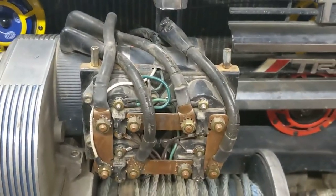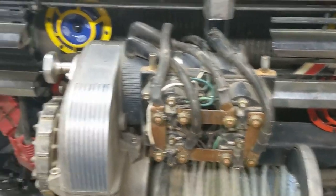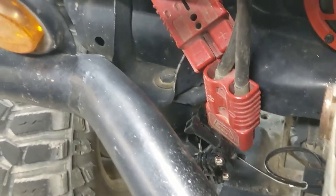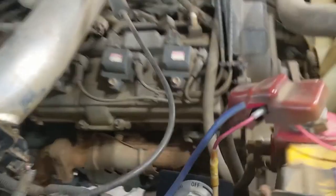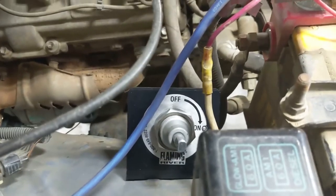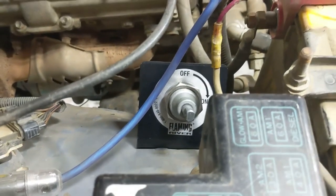I'm going to go ahead and rewire this. I bought new battery cable and I'm going to change it up a little bit. I have this wired up with the Anderson quick connects, and that worked fine, but it just takes up space — it's very clunky. So instead of the Anderson, I put in this battery disconnect right here. That'll keep it from shorting out or running when I don't want it. It's just going to be a positive lead disconnect.